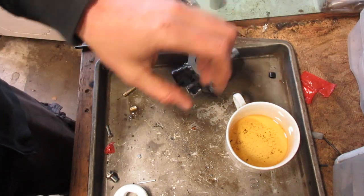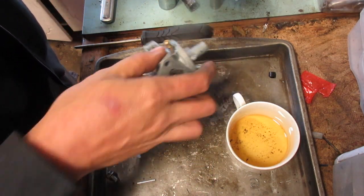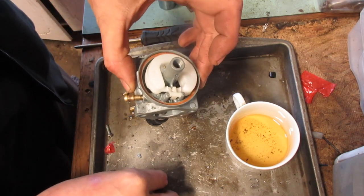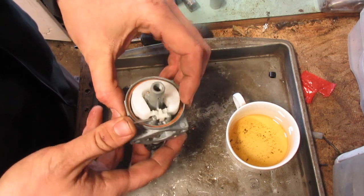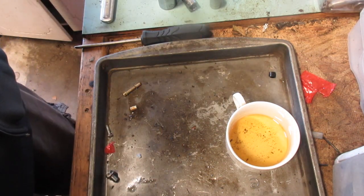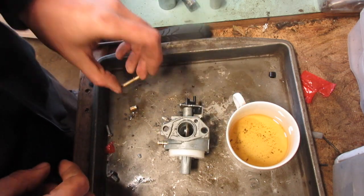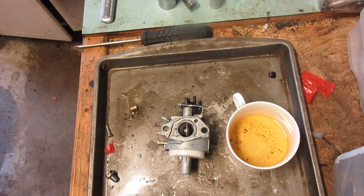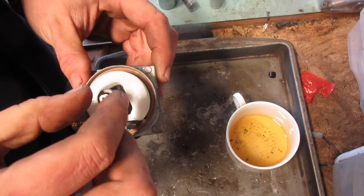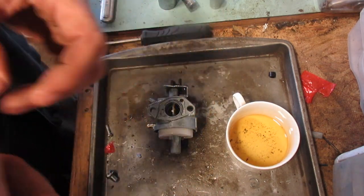Here we are. First thing, let's put the float back in with a needle. I took the liberty of changing the fuel line. I didn't really need to show it because I forgot to push record. So yeah, let's blow into it. But what you didn't see can easily be summed up in a few moments. Basically, there's two different sizes of fuel line, 3/16 and a quarter. You want to put the correct fuel line at the correct location and make sure to put clips in.